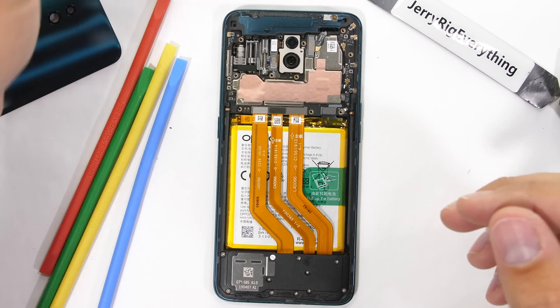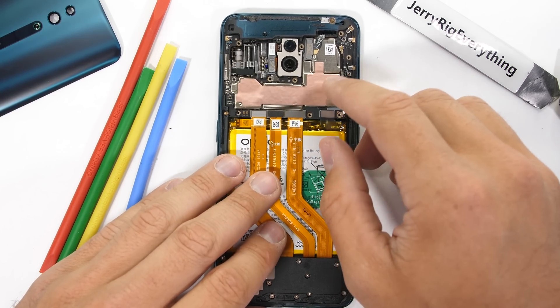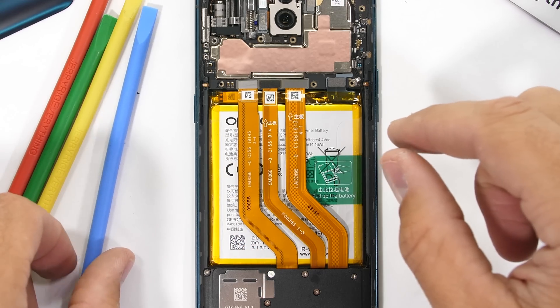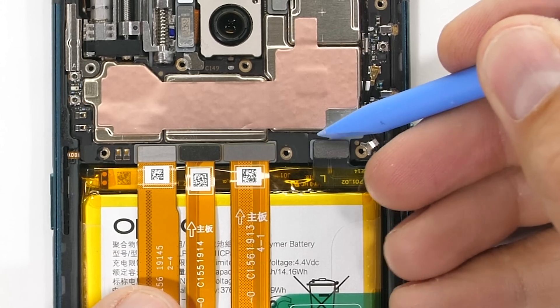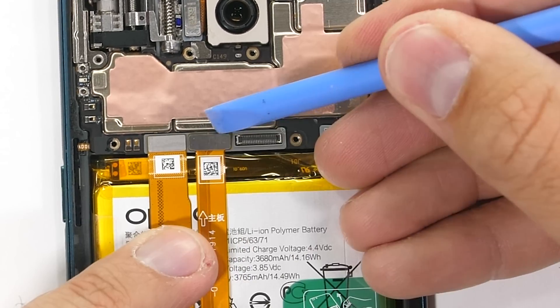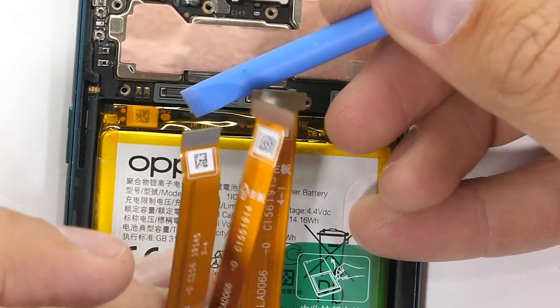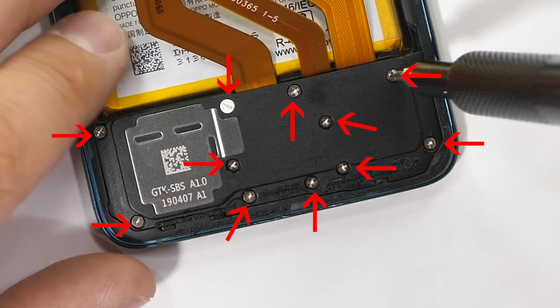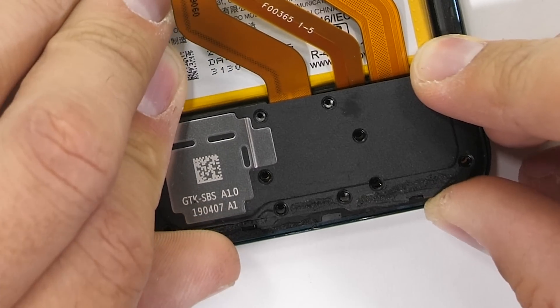As far as a clear phone goes, this Oppo Reno might actually be super cool. We can already see the motor contraption over here on the left, and the gold ribbon extensions add a nice accent to the circuitry. I'll unplug the battery like a little Lego and then unsnap each of the three gold extension ribbons from the bottom of the motherboard. The long ribbons are still in the way of the battery, so I'll remove the 11 Phillips head screws holding down the bottom loudspeaker plastics, and then pop off the speaker.